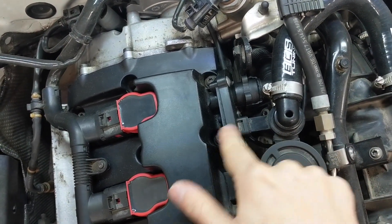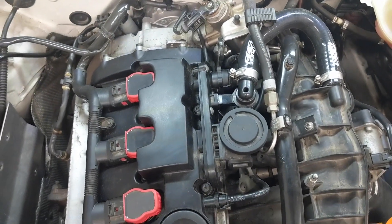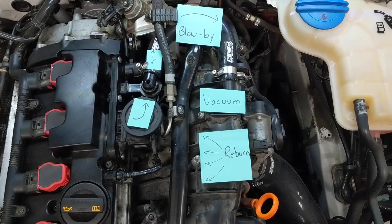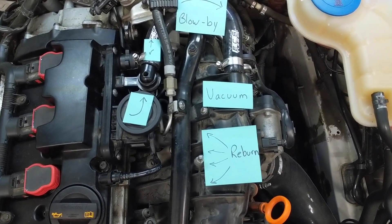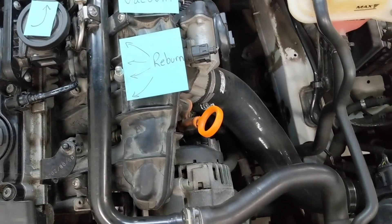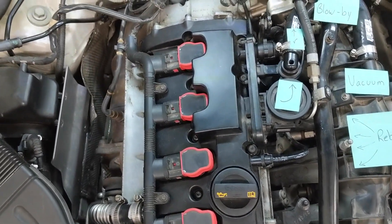Note that this connection point doesn't do anything — it can only travel through this connection right here. Let me bust out the sticky notes to help illustrate how the remaining two scenarios of blow-by travel through the valve. Scenario number one is when a vacuum exists in the intake manifold — that'll be the case when the car's at idle, during decel, or basically any time the engine is not seeing boost. The engine's still sucking in air and running, just not charged air.